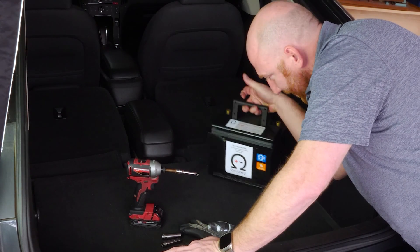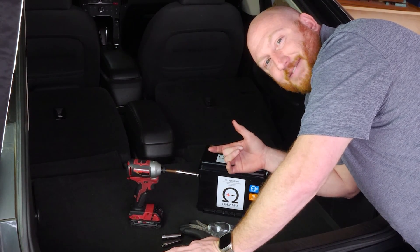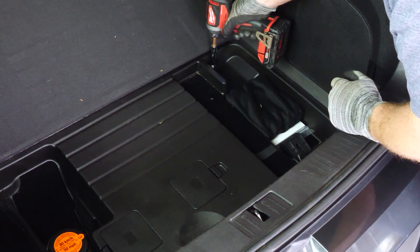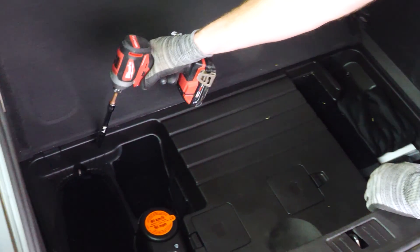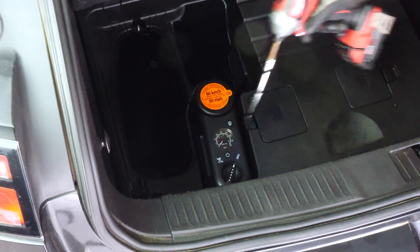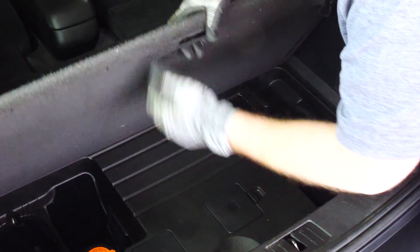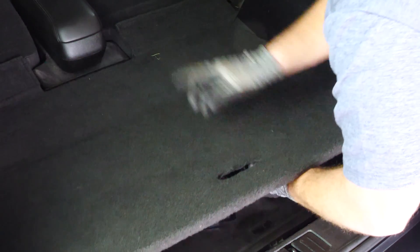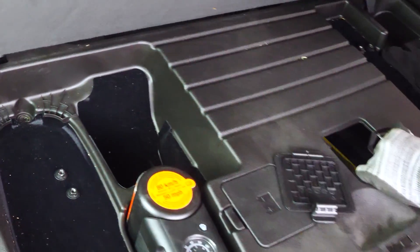This is the battery we're installing today — the H5 battery from OMU. It's extremely light; we'll show you the weight comparison in a few minutes. So we'll lift this panel up — there are four nuts to remove, all 10 millimeters. Then over on the other side. Now that you've got the nuts out, you can lift this whole tray up. It helps to remove one as a place to hold. Then you've got two Velcro strips up here that need to come off to free the carpet, and that whole tray can come out and slide off to the side.